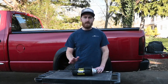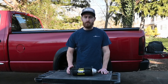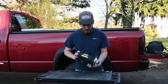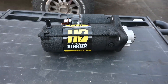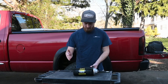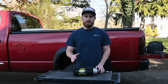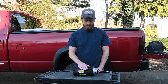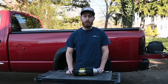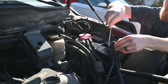The truck was stuck in my driveway so I had time for it to ship. This unit in particular is compatible with 2007 to 2016 Ram trucks with the Cummins engine. It looks like a nice heavy duty unit — they did a wrinkle black finish, not sure if it's powder coating or paint, but it's a really nice touch. More importantly, the gear reduction ratio is 5.5 to 1, which should give it more torque and make it easier on the electrical system, which isn't always great on these trucks. So let's get started.